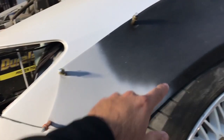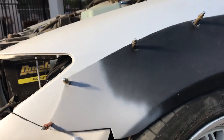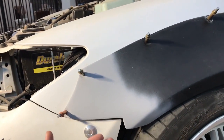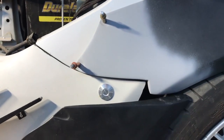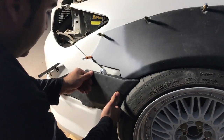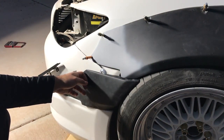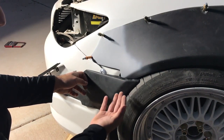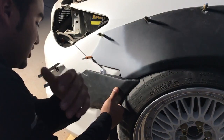That's completely done. Now we're gonna start marking up the bumper cover. The reason we're putting the bumper cover on first is because I felt it's better to put the bumper cover on and once it's on we can cut it all as one single piece and extend the whole piece as one — a lot easier than doing this section and then the bumper cover separately. The first thing we have to do is cut this tab that's back here because it's not allowing it to sit flush. It looks like we are gonna have to cut here and extend it — stick to the original plan — because looking at it now it's not going to fit exactly like this; we have to expand it and push it out a little bit more.